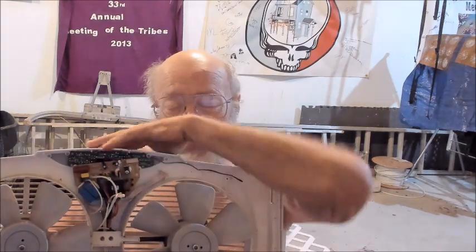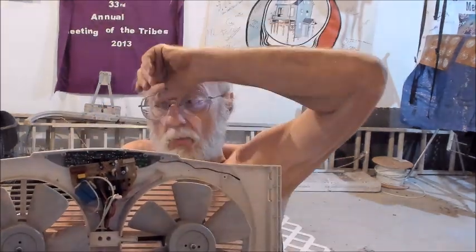Okay, and the fact that I can't turn it on means I'm not getting power. If there was 5 or 9 or 10 volts up here at the front, when I push that on button, it should have lit up. That's all a function of this control board up here. This board right here, all it's doing for that control board at this point is providing power to it. So I don't have any power coming out of this section in my hand. It's not managing to perform the function of changing 120 volts AC to 5, 3, 9, whatever it is, direct current.